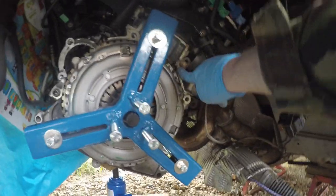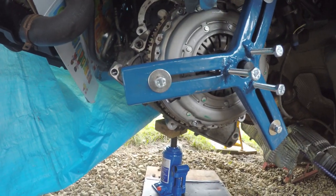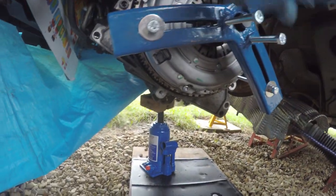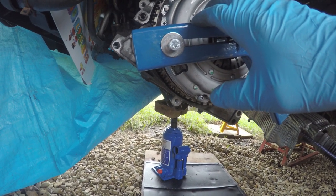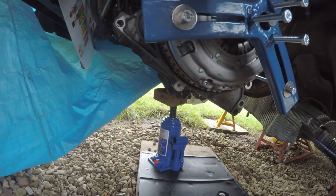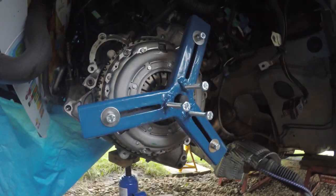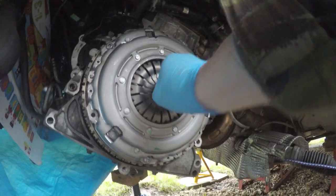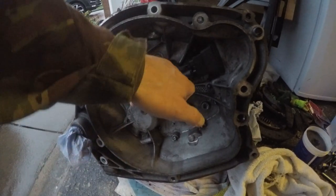I forgot to put the flywheel lock-down thing in. All tightened up to 20 Nm of torque. Unscrew this, put the other two in, re-tighten them up to 20 Nm of torque. Put the other three in. That was a nightmare getting the little guide out — that really didn't want to come out. 22 Nm of torque.